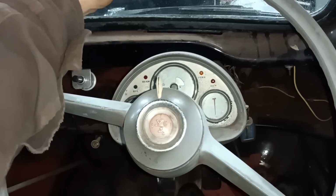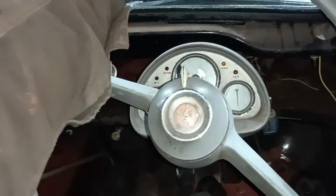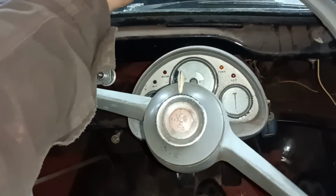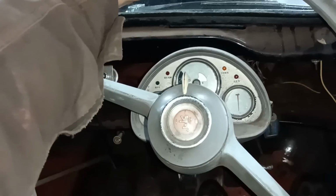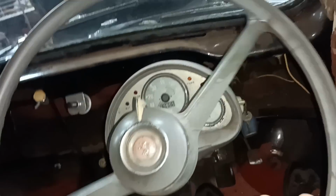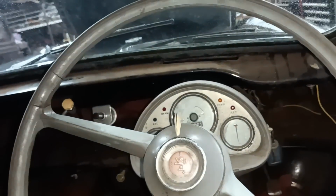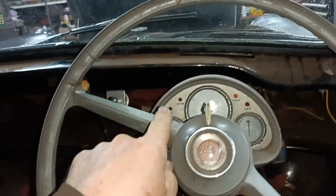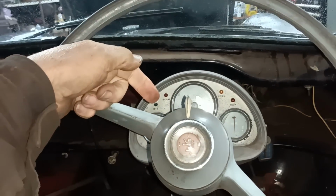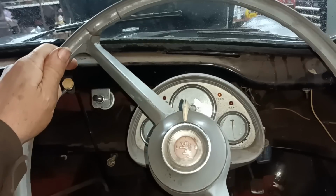So let's count that again then, to put a mark on it, I suppose. 1 turn, a bit awkward. 2 turns, yeah, that's back to the stop there. So, 1 turn around there. That is the midpoint of the box, and you can see there that this spoke is this side of the beam and the oil light. So that is the midpoint of the box, like that, and that's where my wheels are straight.